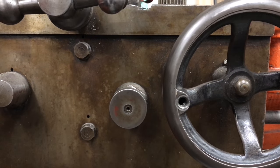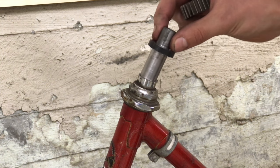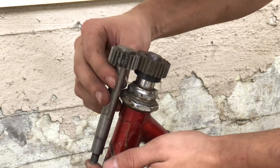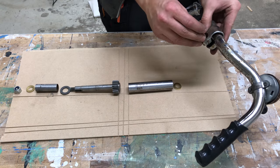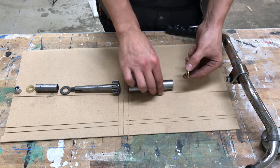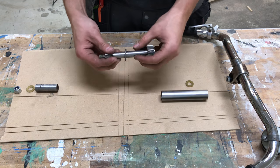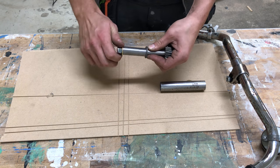The first part I made was the steel piece that I turned on the lathe, and this is to attach the bigger of the two gears to the fork of the bike. Then it was on to making the part that will connect the handlebars back on the bike. For this I chose to weld the old handlebars and stem on top of the gears that already had the shaft in it, and then I would keep the shaft in a steel tube that I could weld onto the frame of the bike.